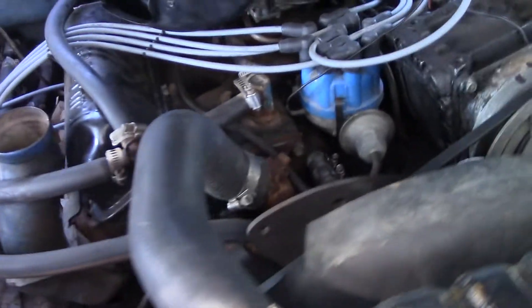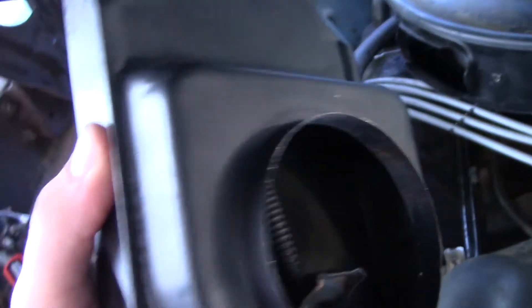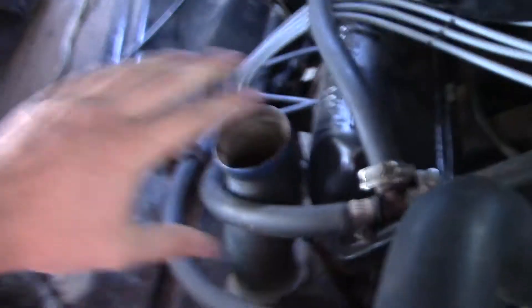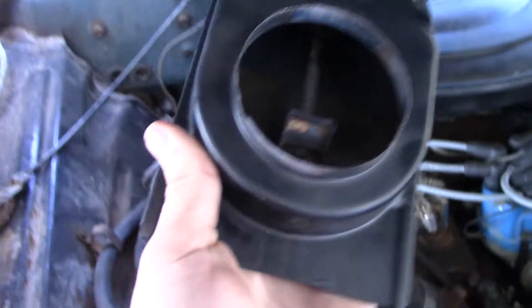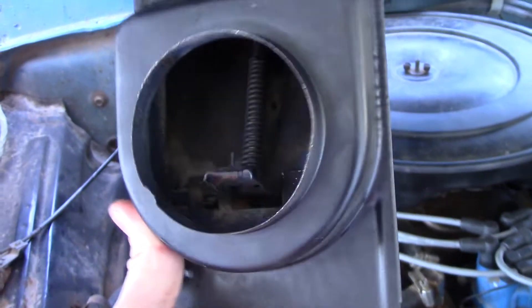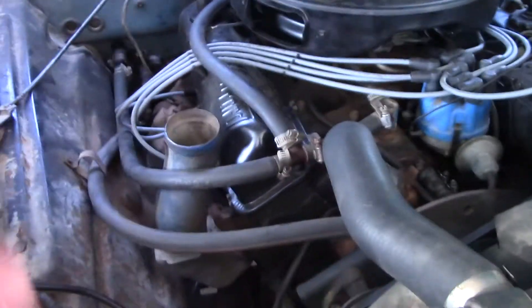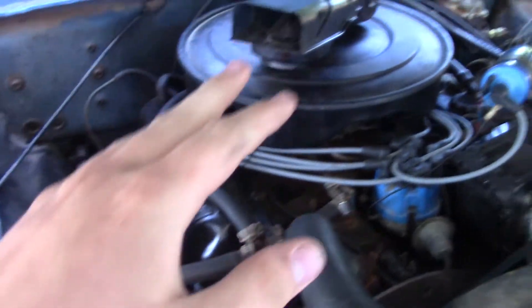It ran great. Always, if you see this and you plan on using your car or truck and it's got this set up on here, get rid of it. It's not breathing well. This might even be a heat-actuated deal on the bottom that's just not working, that's supposed to close, because it definitely doesn't like to start cold. But with that hot air, I imagine it does help. But once it gets hot, it doesn't need that anymore.